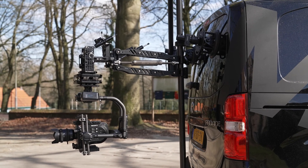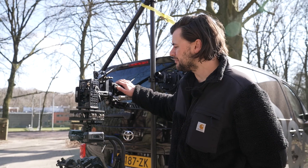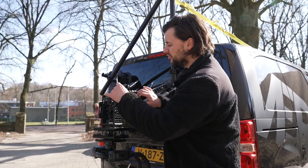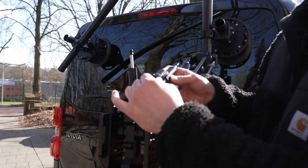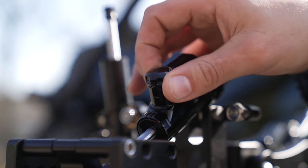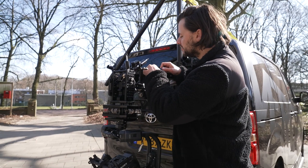The Airwave includes a three-way damping system, and I'm now going to show you how to adjust it properly. On top of the three-way damping system is a knob where you can turn from soft to hard. I like to start completely at soft, so every step is going to be on soft for now.